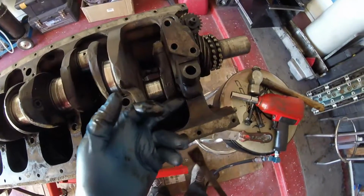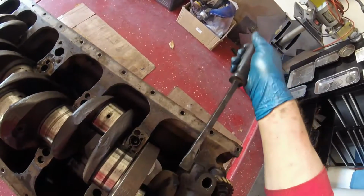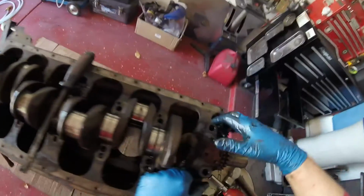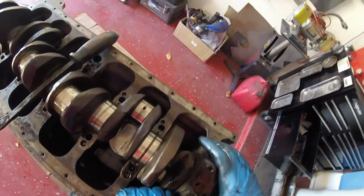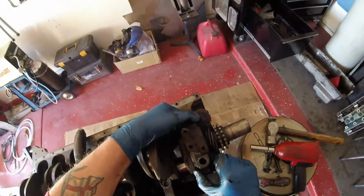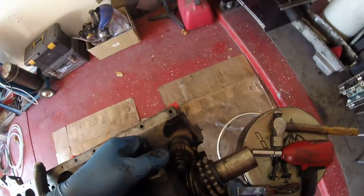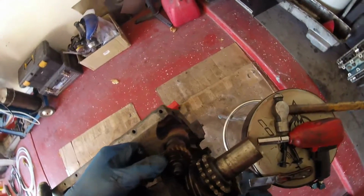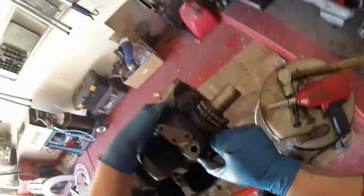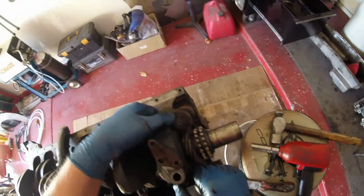Oh, one thing I didn't mention or note for you guys, a lot of these have a lip that sticks over so you can get underneath and just gently pry until it gives up to you. And then it comes off easily, he says, because every one of them's got a dowel. Oh, and I'm fighting, aren't I? Of course I'm fighting the timing gear. Sorry, it's the distributor and the timing gear. I've got to get that off first.